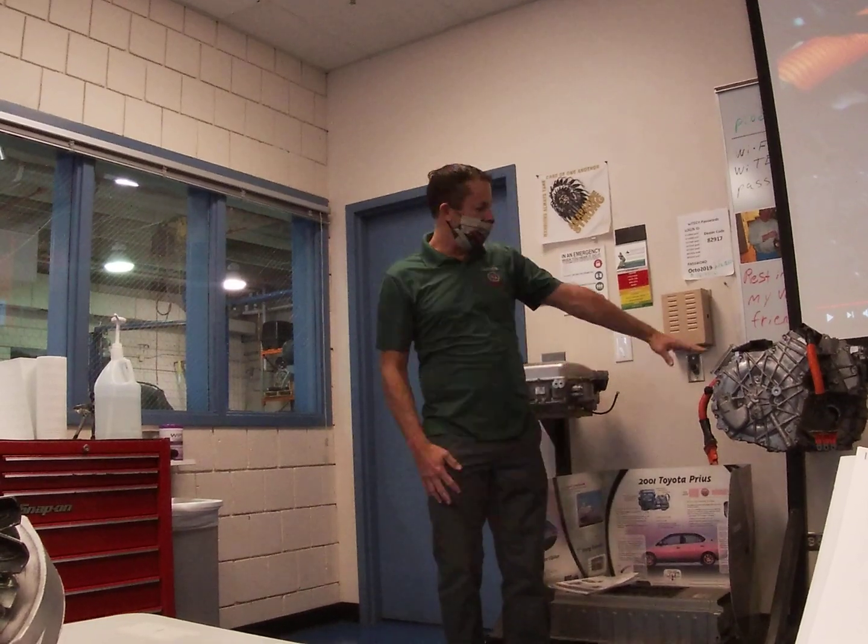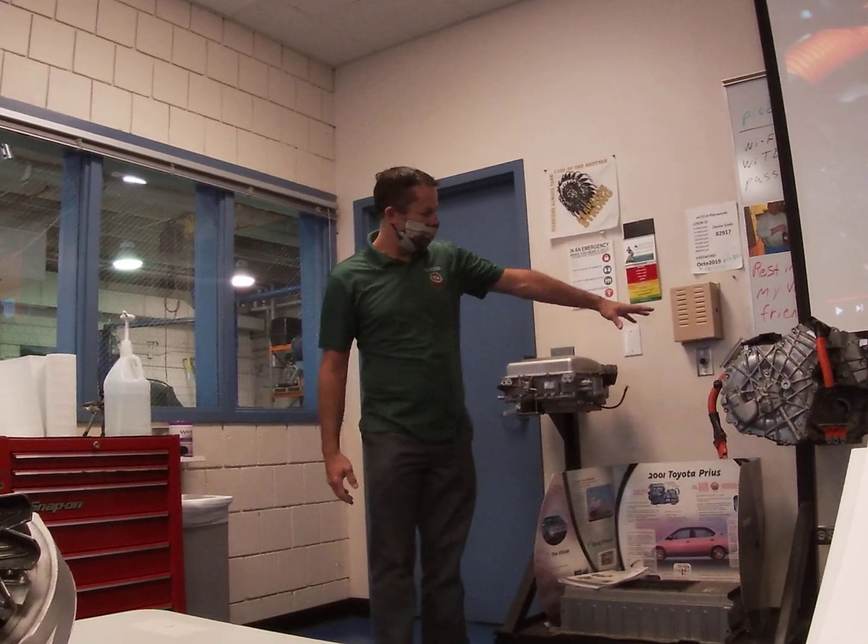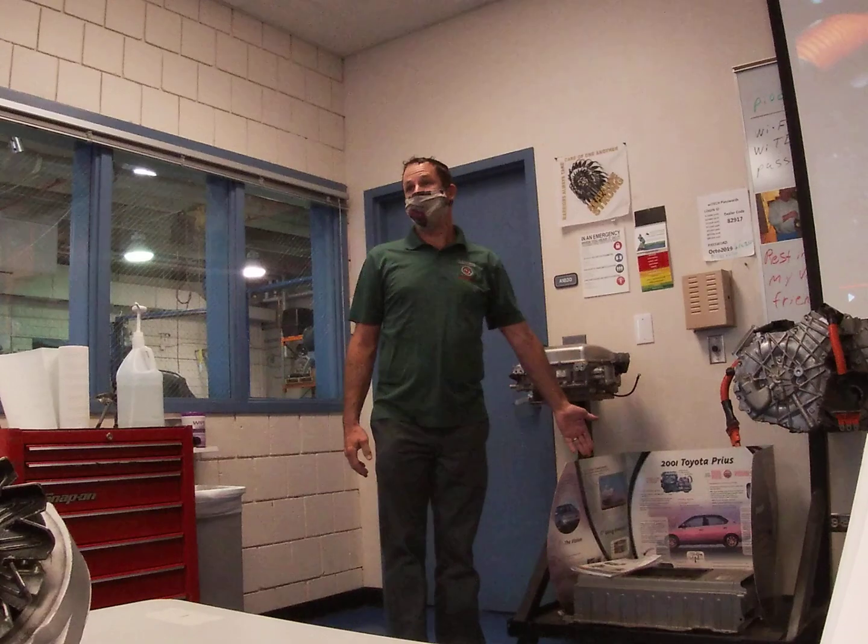When it comes to regen braking — which I love, that's my favorite part of this entire system — all that kinetic energy that's lost when you're hitting the brake pedal, say you're stuck in traffic on Broadway, is just given up in a conventional car. But in a vehicle like this with regen braking, you're not giving it up. It's kind of like the sensation associated with downshifting in a manual transmission — that engine braking — but now we're capturing that energy by allowing the motor to become a generator. We then produce alternating current, convert it to direct, and charge the battery. If you look at the fuel economy numbers on a vehicle like this, in most cases the city is as good as or better than the highway, which is a rare deal.